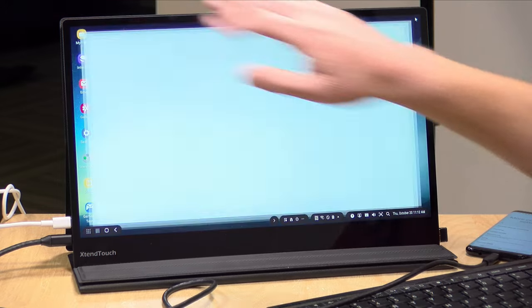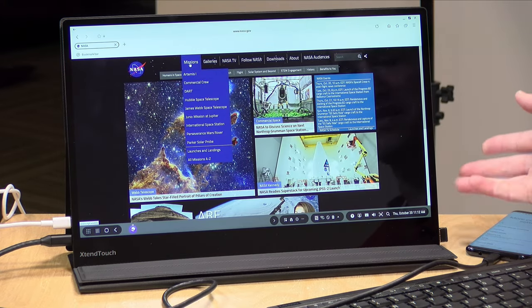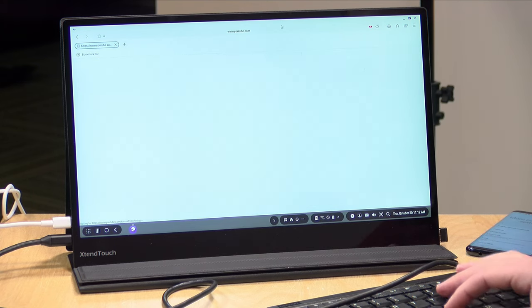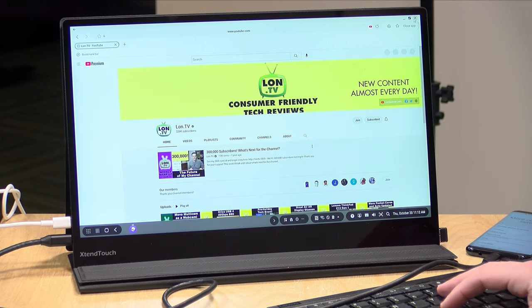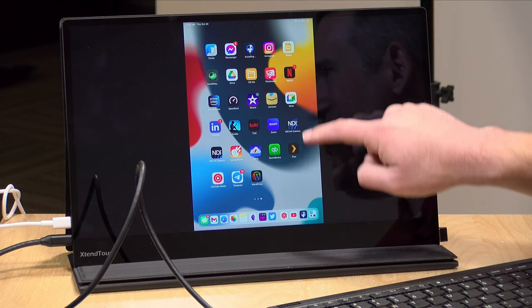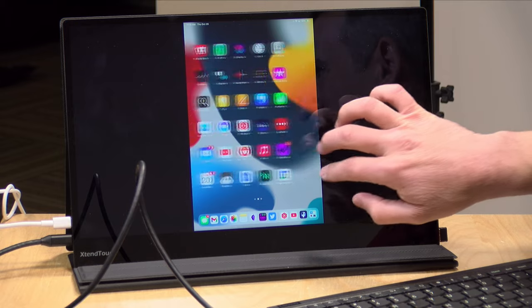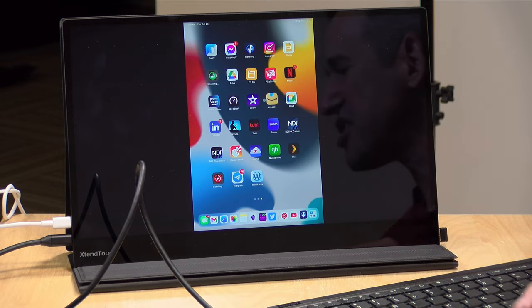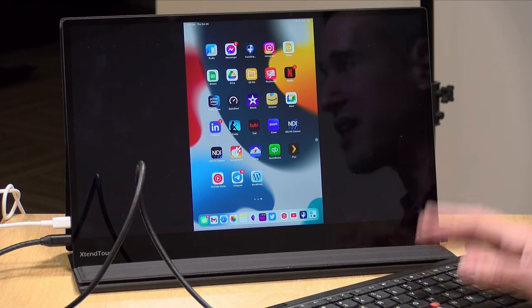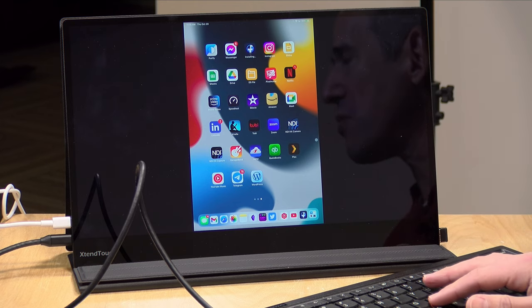I've plugged in a Samsung phone that supports DeX, and sure enough it works on the display with no issue — touch comes right up and functions as expected. My keyboard dongle is also working over OTG, so I can type on my keyboard through the display. It's a functional DeX device that's pretty much plug and play. I also tested an iPad with a USB Type-C connector — it will output video, but the touch functionality is limited. Some gestures work, like two-finger scroll, but for the most part the iPad will mostly just be a display output. The OTG support does work for keyboard and mouse combos.